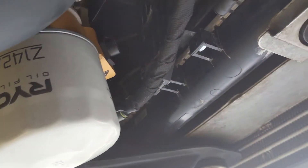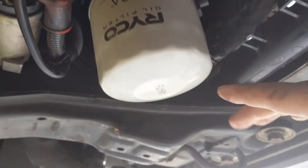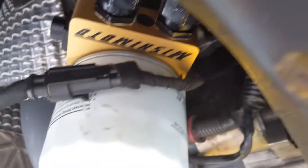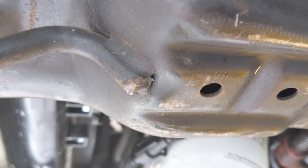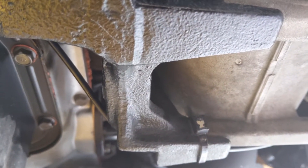I've zip-tied it there to the bottom of the AC compressor. At the moment it's running around into a split connector because what I've got here is a four-wire cable coming in. Three of which are used for the pressure transducer, which is a five-volt reference transducer, and only two of which are used for the temperature probe, which is in the Mishimoto oil cooler. That's a two-wire probe, so the four-wire cable is sharing the ground wires between these two sensors, but they have different sensor wires.